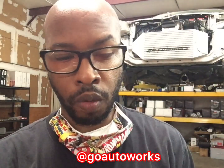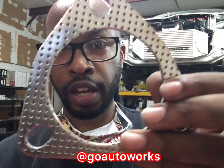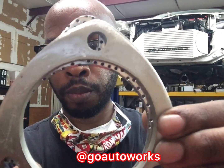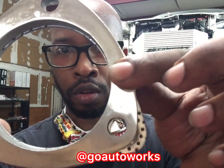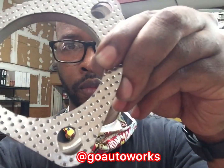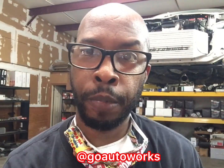It's raining outside now, so it might be hard to see, but this is what I was saying about the flanges. This is the gasket it came with. This is your standard 3-bolt flange. You can see all the offset in the holes. When you line one hole up, the others are off. So I'll just do away with that flange completely and V-band it. But yeah, that's it.